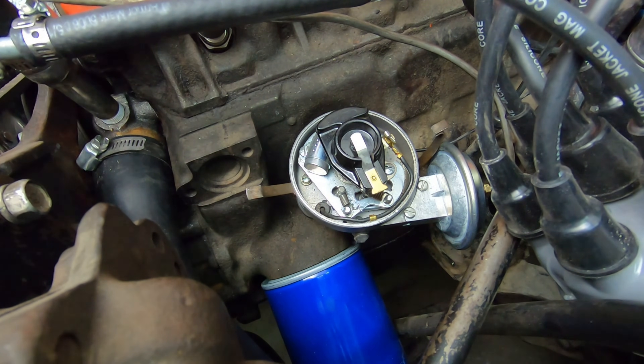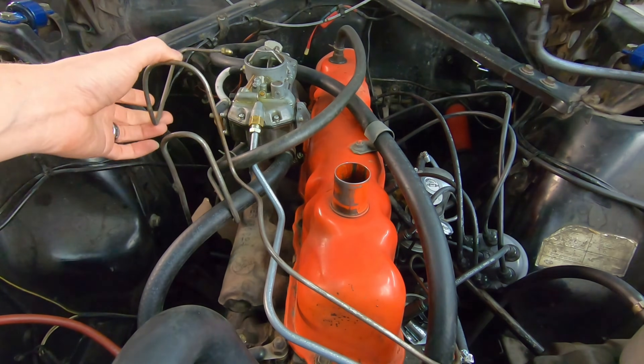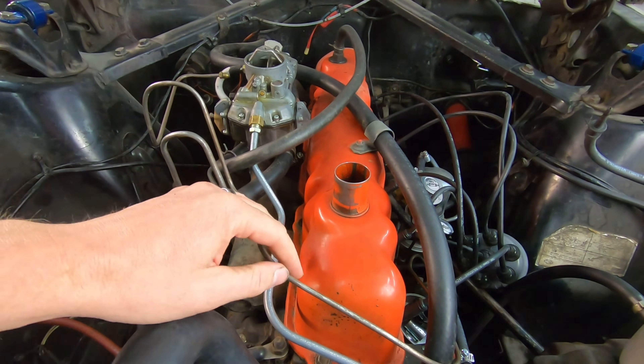As you open your carburetor valve or your venturi butterfly valve, you're allowing atmospheric pressure to enter the engine, and so your manifold vacuum actually goes down. This line, this port, is going to be on a ported vacuum controlled via the spark control valve. I'm simulating what's going to happen there, and that's going to give you your ignition advancement when you accelerate, because you want more timing advancement as you accelerate. What we've demonstrated is that it is working properly — it holds vacuum, there's no leaks. So that's good.